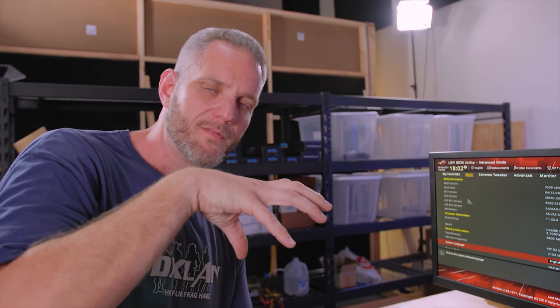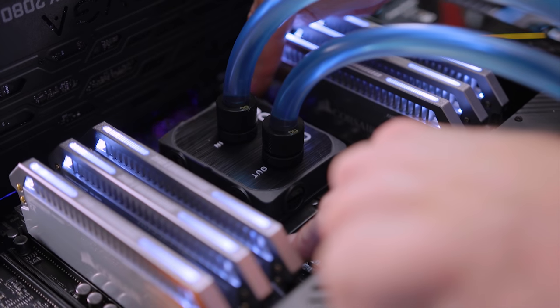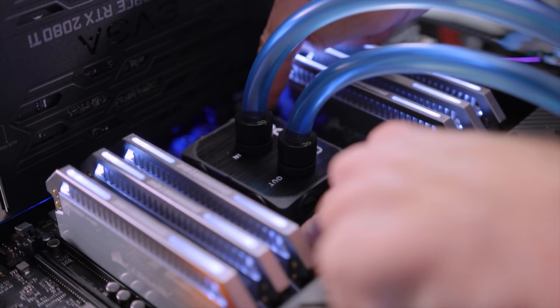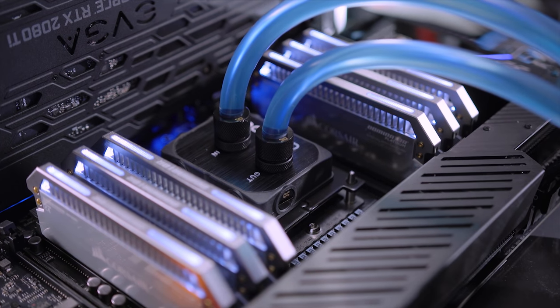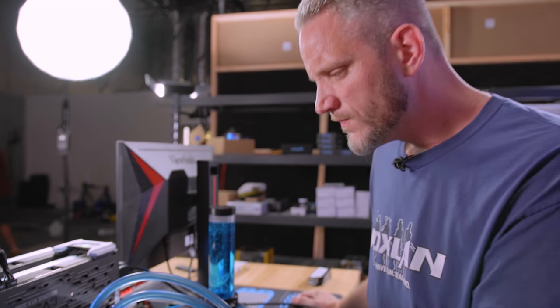The reason Threadripper states that's important is that a certain amount of tension is needed for all the pins to be contacting. So initially we were only getting 32 gigs to show up, which means two of our DIMMs weren't showing up. So I just went, okay, I'll keep tightening it. You tighten the outside corners, or the opposing corners, until the threads stop, because it bottoms out. Then the two in the middle, one here and one there, you tighten those down next. The thing is, those threads don't really stop, as far as I can tell. They just kind of keep going, and I don't want to cause damage to our CPU. So I don't think I had those tight enough. When I turned off the system and tightened those down further, we got all the RAM to show up. So just a little note to mention there.